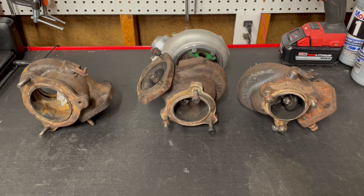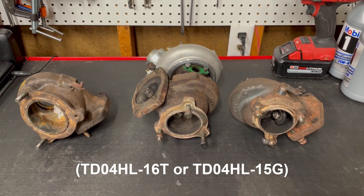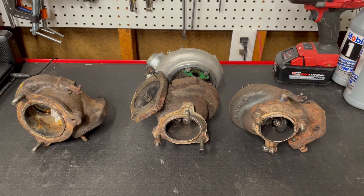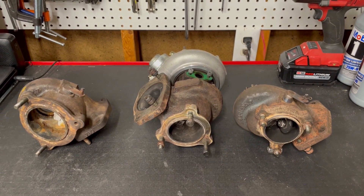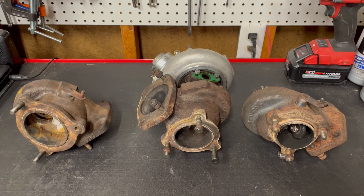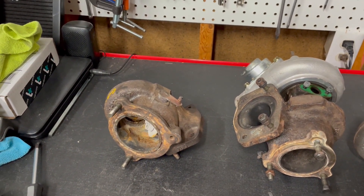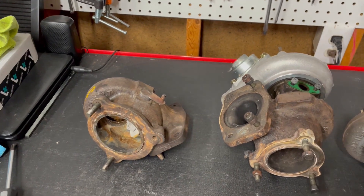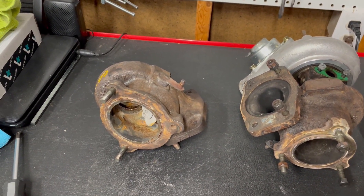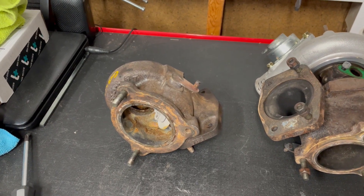I can say with a high degree of certainty that every one of these came from either a 16T or a 15G. In fact, I believe the one on the far right came from a 15G from an 850 series turbo. Depending on what year you get will dictate what type of flange you get. The straight flange in the middle came from an S70 T5 — a 16T turbo with the straight flange. The angled flange came from an early 2000s S60 T5. Angled flanges are probably going to be the easiest to find in a junkyard just because those cars are newer — there were a lot of them. The S60s, and even some of the V70s from that era — anything with a T5 in the early 2000s will probably have an angled flange.